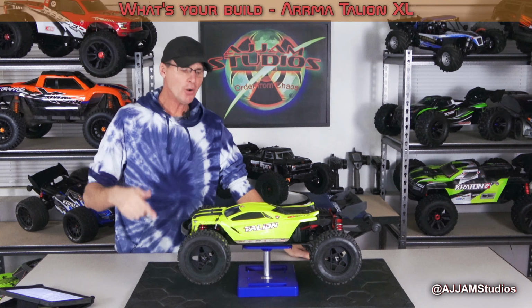So the arms take up all of the impact when you land a little askew, the arms will absorb that. That's how we look at it here, and it seems to serve us well. So when we run it this way, we like the bigger, gnarlier, really good hub carriers out front, because those protect all of that. The arms take up the extra impact, and the internals don't suffer nearly as badly. If you take a huge impact here, the arms will absorb a lot of it, and it won't transfer as much power to the hinge pins, which means in the long run, your car is going to hold up better.